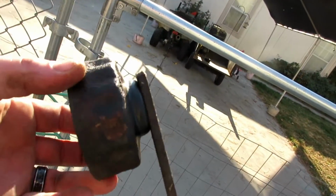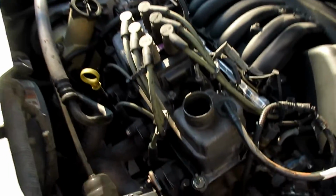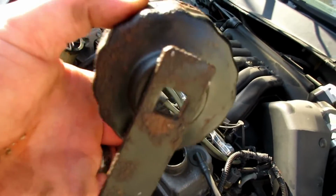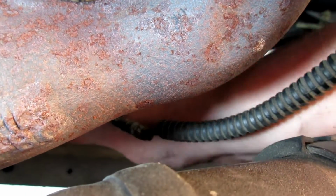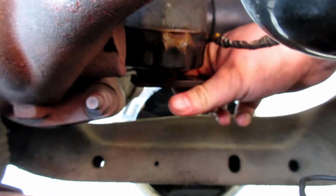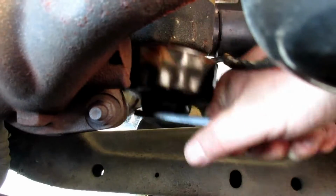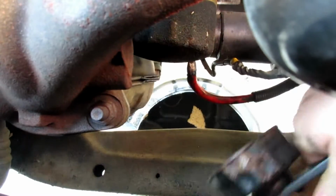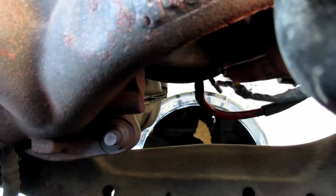The slip wrenches are okay, but I much prefer an exact fit wrench for filters, especially in these hard to reach areas. So we're gonna get this guy on there and I'll show you what it looks like. The filter wrench is on it right now, and we're just gonna turn it. This one's easy, so I don't have to put a wrench on it. And once it goes, you'll just be able to do it by hand here real soon. There we go. So now we're just gonna reach down with our hands and just walk this off.